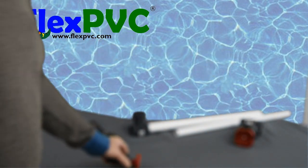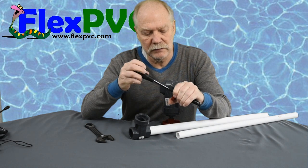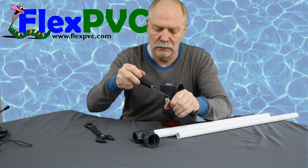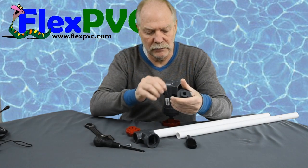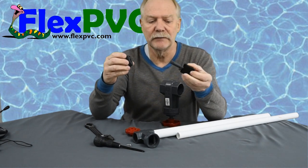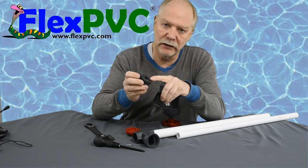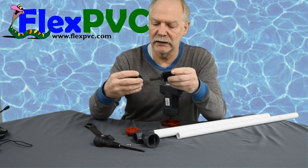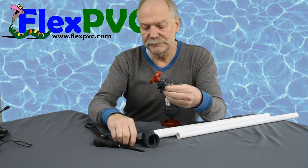Anyway, so that's how you take them apart. I'll just take a screwdriver and take the screw out. This should pull off — there you go, now this comes out. There's lube on here. There should be an O-ring in here — make sure this O-ring is not damaged. Sometimes when the machine puts the O-ring in, it can misalign it and then it gets squished or something. That might be the problem why it won't go up and down. But that's it.